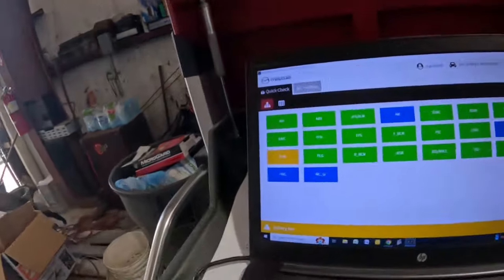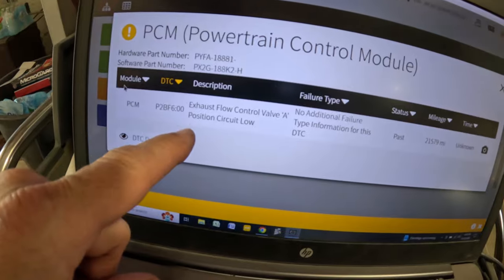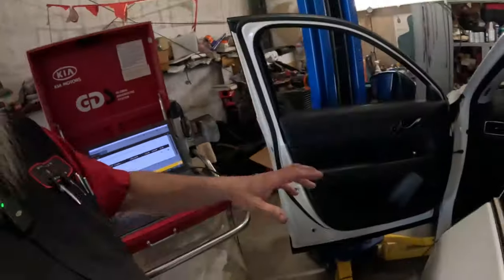I'm going to turn that off, turn the key back on, and come back over here to hit that recycle button and see if there are any other codes. It could have some other issues because it was wrecked at 70 miles an hour. It shouldn't be that four-wheel drive solenoid because we just fixed that open circuit. It's going back to PCM — exhaust flow control valve, position circuit low. Circuit low usually means a short to ground. Circuit high is usually an open circuit — take that with a grain of salt.